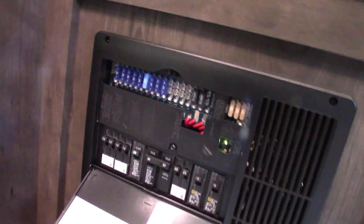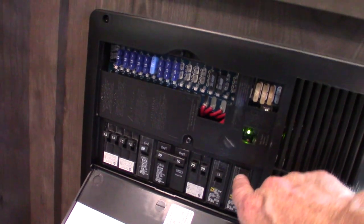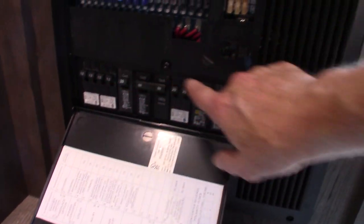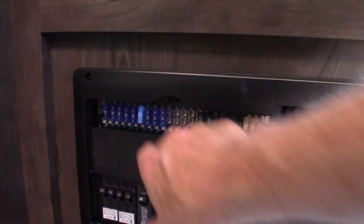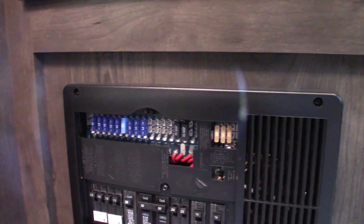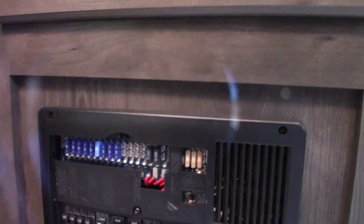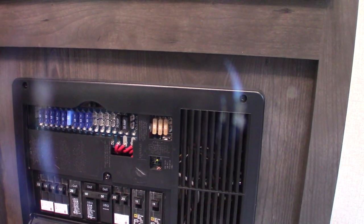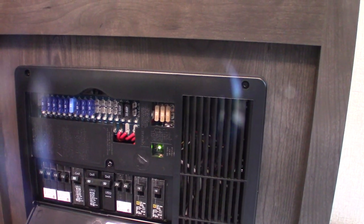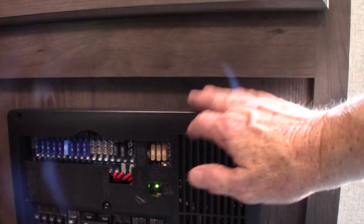This device is the power converter — it converts AC to DC power. When you're plugged in you have 120V AC just like at home, and these are breakers like you'd have at home — it's like a distribution center and they're all labeled. The power is converted to 12-volt DC, and you can see the 12-volt fuses here. It also acts as a battery tender — it senses how much energy your battery needs and acts accordingly. If the battery is fully charged it'll just trickle a couple amps; if it's low it'll send 10 amps or whatever is needed. So as long as you're plugged in, this is also a battery charger. When towing, your tow vehicle's alternator will also charge the battery.